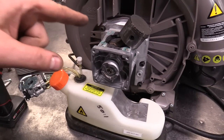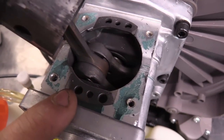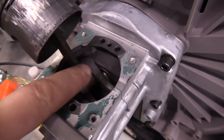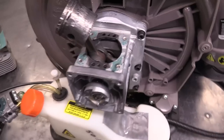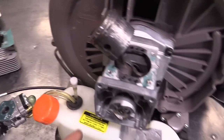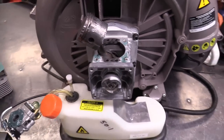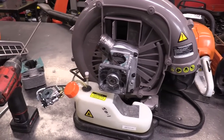I can see one of the crank bearings here and it does not look totally discolored. The connecting rod is not discolored either — not blue as if it got really really hot. Usually the piston rings and cylinder will give out before you damage the crankshaft or connecting rod. So yeah, I think this would be a good candidate if I can find a cylinder kit for it.